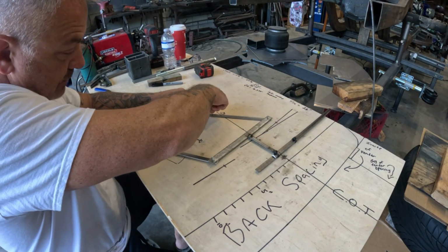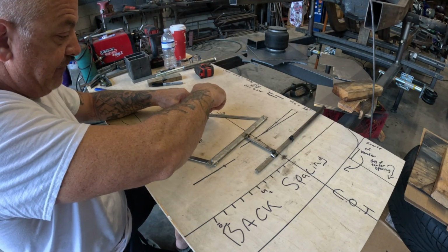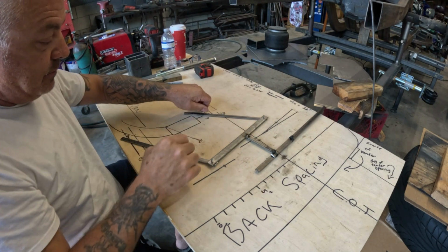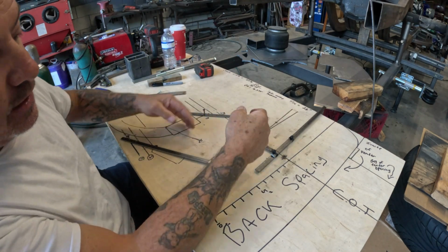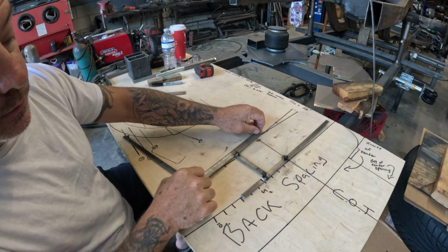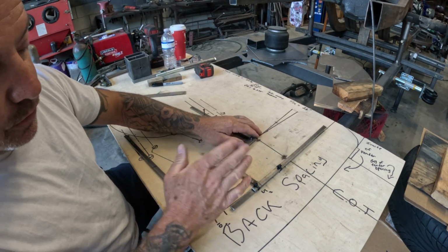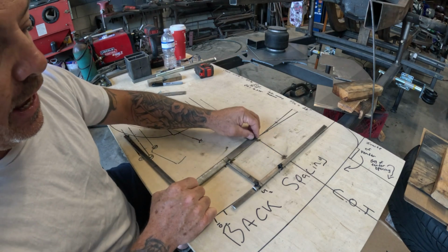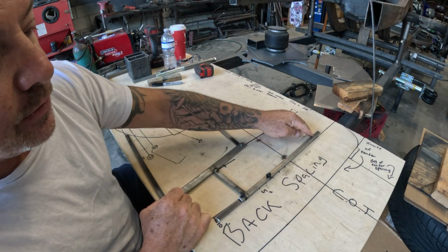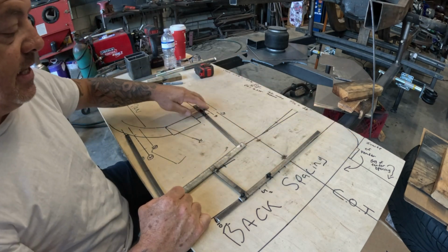Fair enough. Take your screw out, move it 1/2 inch. You can just try the upper first. Your upper, you're obviously gonna have negative camber, LOL. And you can see that you will always have negative camber, but your arc is still here. And your tire is still almost into the inside of the fender. So this is not going to work.